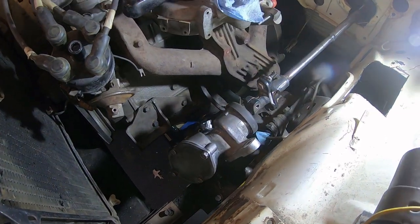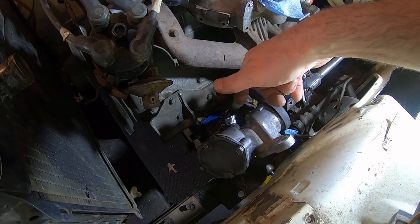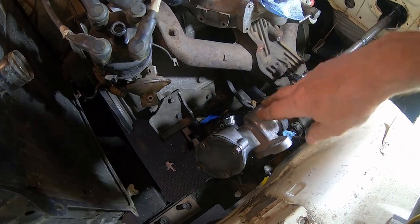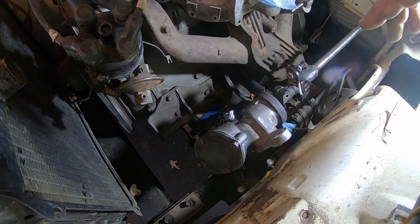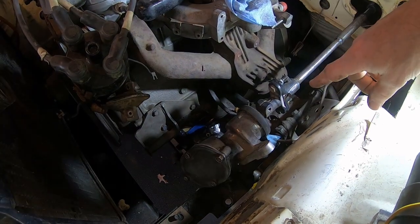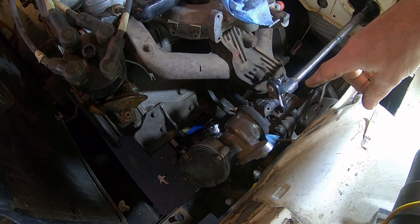The more I think about it, it's how it is on the R50. I think I'm gonna have to put a joint here. Because obviously, if that joint was perfect, the cab is still rubber mounted, but this is frame mounted. So I just mounted the body, by the way. The body's all mounted now. But I think I need to put the isolator. I really don't want to put the rubber there because the motor's there. So maybe a regular U-joint? I don't know. I may put the rubber back in there temporarily and see how that feels.